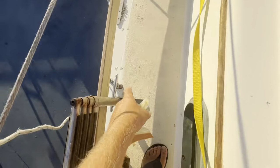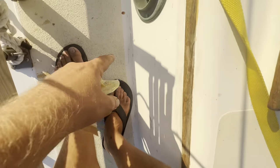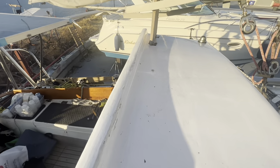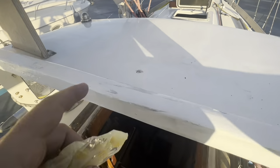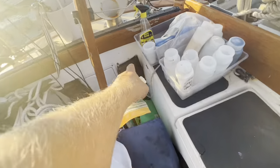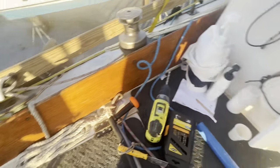While I was at it I also over-drilled my holes for the swim ladder and filled them. I filled in a little whoopsie hole where I actually only drilled to the side of the boat, filled in the hole for the experimental wind sensor test, filled in these old cockpit locker latch holes, filled in the old snap hole, and filled in the holes where the old swim ladder used to be. Once that dries the boat will be watertight - I'll hit it with an angle grinder to make it flush and paint over it next time I have paint out.